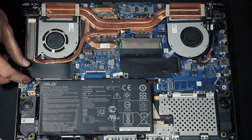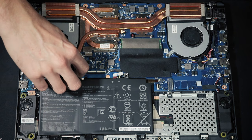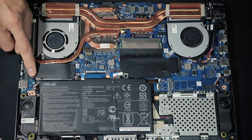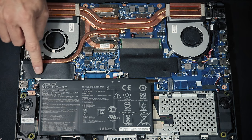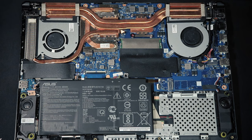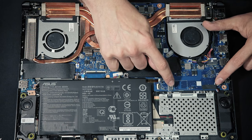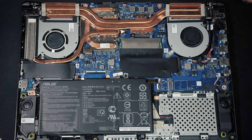As you can see, below this black piece of plastic we have the system M.2 SSD, which usually has your Windows or Linux installed. On the other side we have the port for the second M.2 SSD, which has to be a 2280 M.2 SSD — meaning it must be 22 millimeters wide and 80 millimeters long — because otherwise it won't fit.